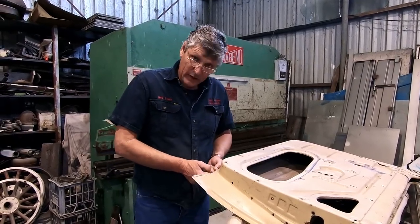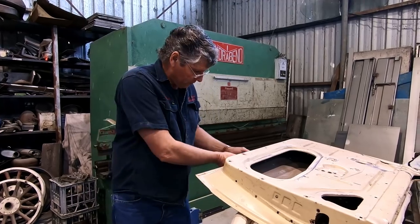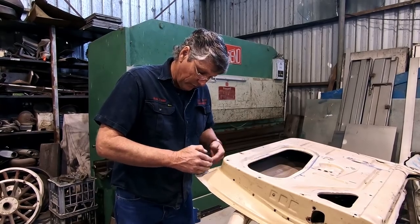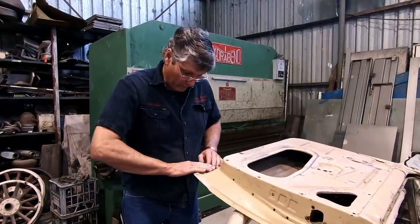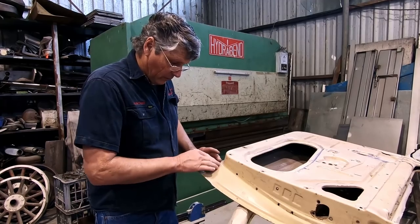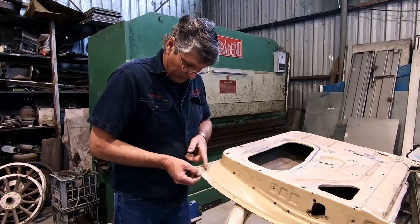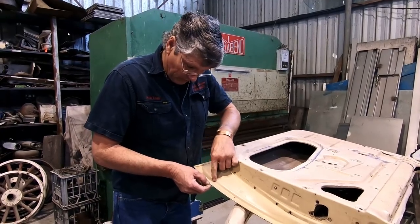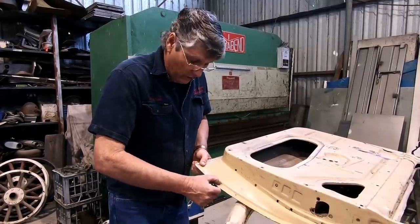What we're going to do is take our piece of metal that we're going to shape our new piece from, and I'll clamp something along the frame of the other door supported back here on the good part of the frame. Then we can put our piece of metal on and start working from this edge so we know where we're coming back to get it this way right. Once that's done, we can make the little wrap across there, make sort of almost like a part of a cone, curl it a little bit. We know roughly 25mm, inch in from the corner of the door, and we've probably got 13/16ths, so about 21mm up there — it sort of runs in there, we can shape that.